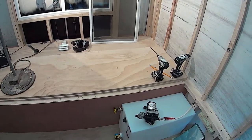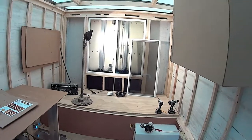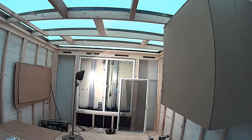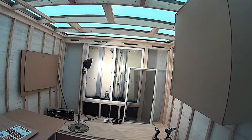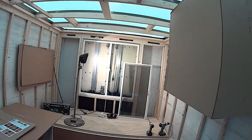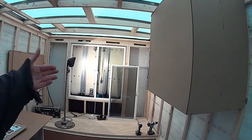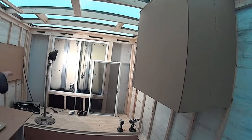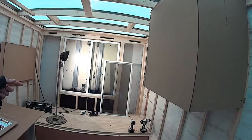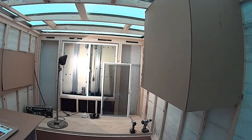I've got a piece of plywood down here to cover up the insulation we put in. Most importantly, check this out — we got a window! It's a four-foot by four-foot window, and it was fitted in fairly carefully. It has a nailing flange that I had to set back so the window went in from the inside of the van, and then I put the studs in afterwards. The studs are ripped down to about two and a quarter inch — I'll show you what we're talking about here.